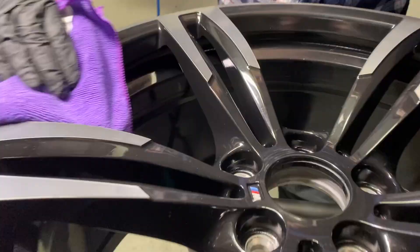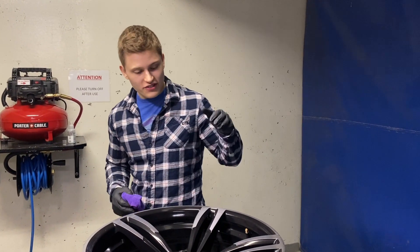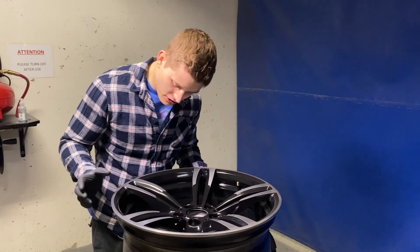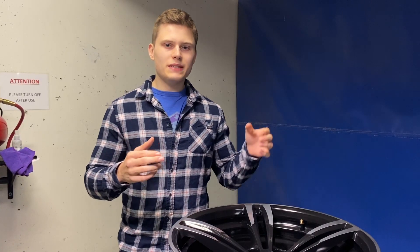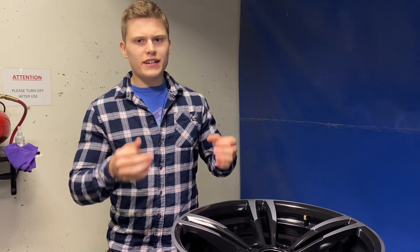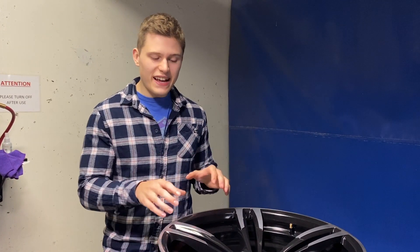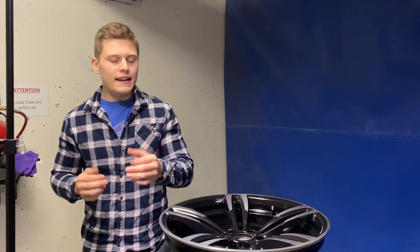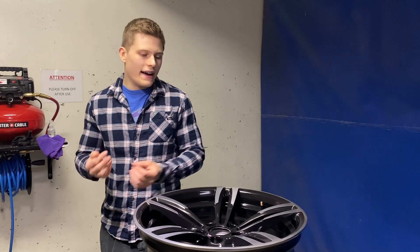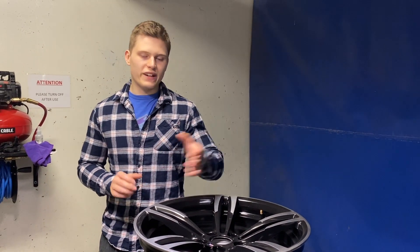And like that, we just apply it right on. With that, we're all done. This wheel looks amazing. Even though this is a matte ceramic coating, this gloss wheel does look shinier, and the color looks deeper. So I can only imagine how much better it would look with an actual gloss ceramic coating. I know how tedious it seems having to take all four wheels off your car and leave it on stands for three or four days — but you actually don't have to. If you want to leave your wheels on your car, you could degrease the face and try to reach under the spokes to get the back as well, and then ceramic coat the face and the lip of the barrel. The inner barrel is always going to get really dirty with brake dust. The faces, though, with a quick rinse, all the brake dust will come off almost instantly, unless you drive the car for weeks on end without washing the wheels.